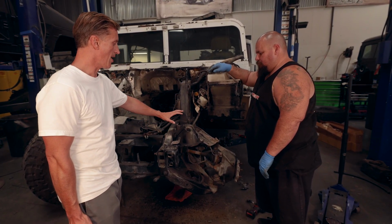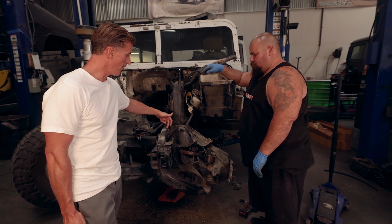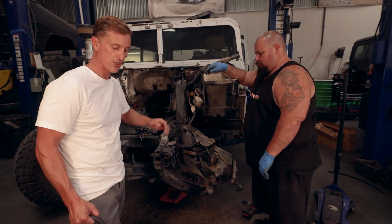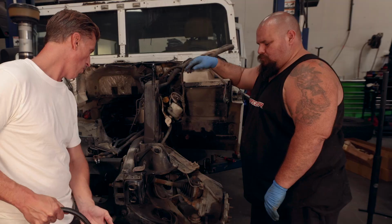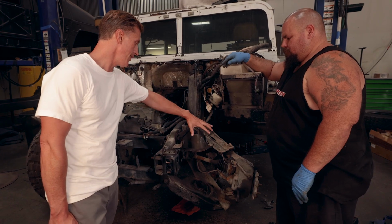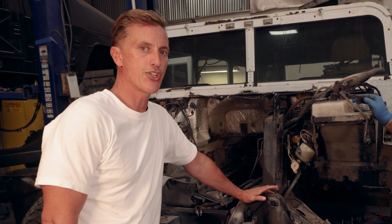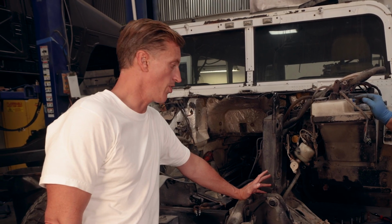So we're talking about doing a whole new spring perch up here that has a relief cut on the back side, where you can feed this reservoir through there, or maybe modifying this spring perch. Because if we have to make this, the problem is we're making a very limited production number of these. There's going to be 4 per kit, obviously.